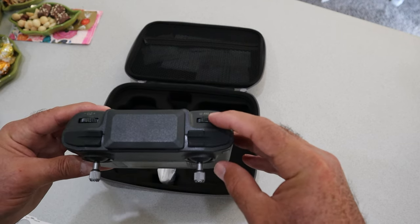I'm going to bring this guy up and back and see if it'll go into return to home. Reached height limit — it's restricting height and distance while in low power. It should go into low battery RTH, and if it doesn't here in a second I'll click it into return to home. I'm watching the battery meter across the top — you can see that red line in the top left. I am not going to risk it — I am going to put this guy into return to home. That's the button on the right-hand side of the controller. That put it right into return to home.